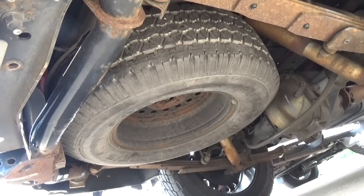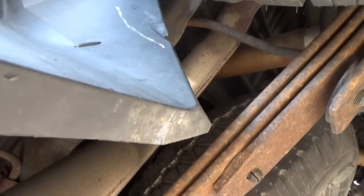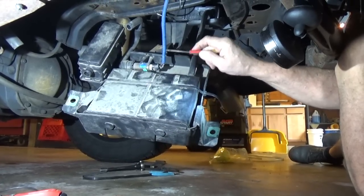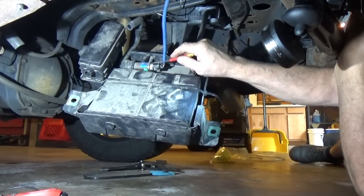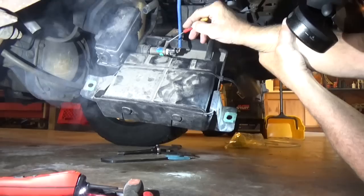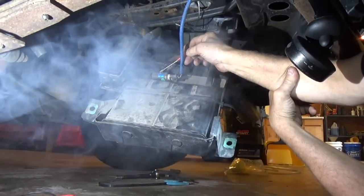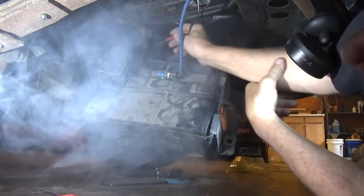On this vehicle the canister vent valve assembly is mounted above the spare tire, and as you can see there is no access without removing the spare tire first. To save time we've already done that and lowered down the canister vent valve assembly so you can see it. Most vent valves are easy to access, except on this vehicle we had to drop the spare tire. In the rest position the vent valve is usually open, where smoke will be coming out this tube. You can see the ReadySmoke machine puts out plenty of smoke, and this is verifying it right here.